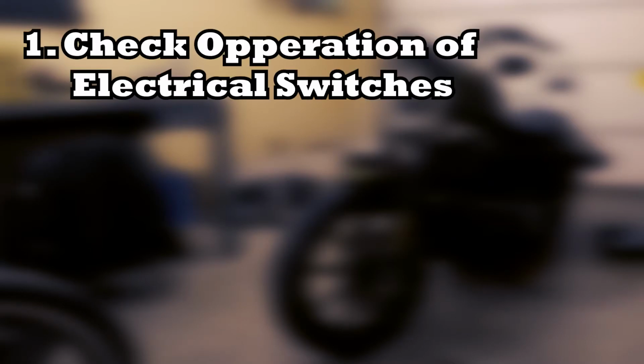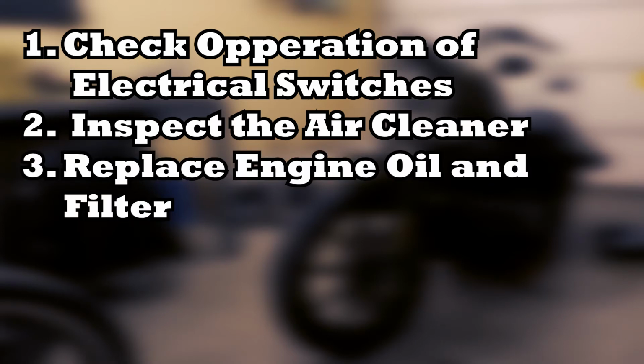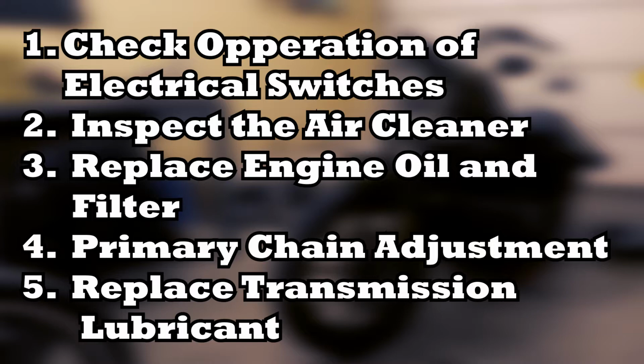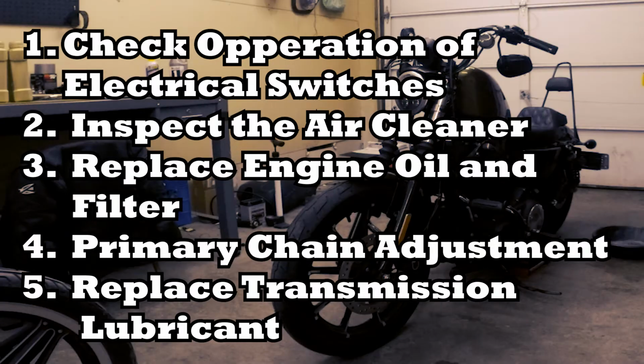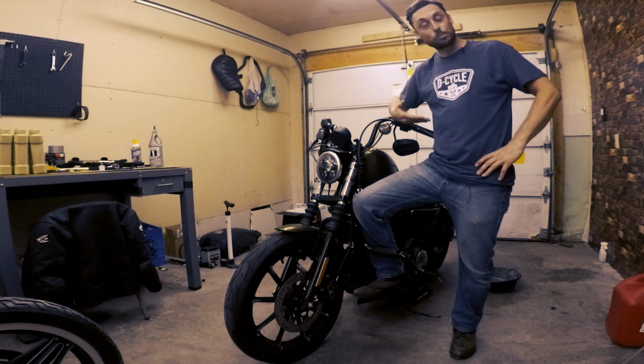So in this second video, we'll be doing a few things. In the last video, I said we were going to check the operation of the electrical switches. We didn't do that, so that's the first thing that we're going to do in this video. We'll also inspect the air cleaner and service it if necessary. We'll replace the engine oil and filter. In fact, that'll be one of the first things that we do. We're going to check the primary chain adjustment, and then we're going to replace the transmission lubricant. So let's get started.